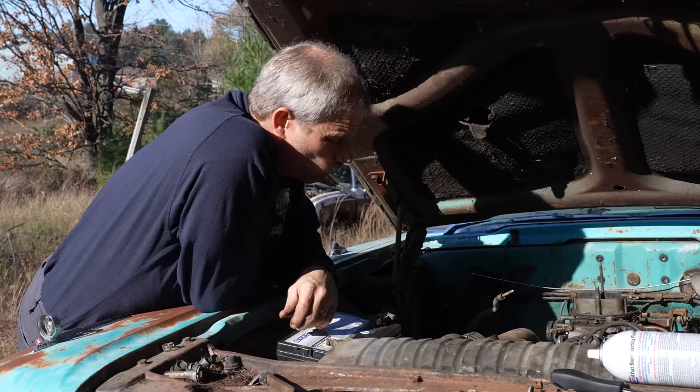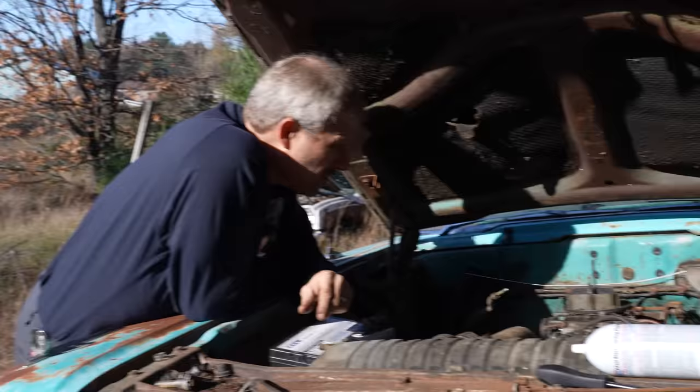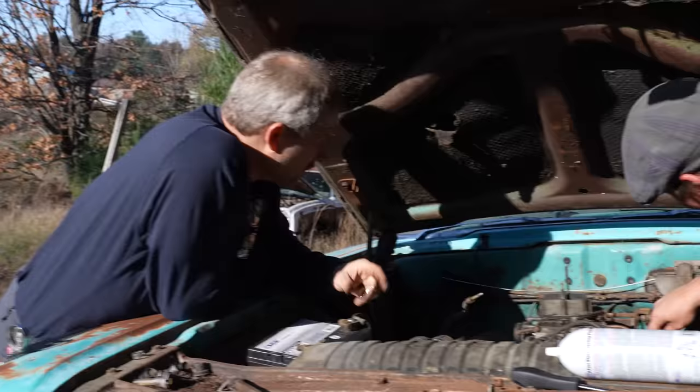I mean, look at it sitting here, smoldering. And there's no reason for it to do that. No. Other than it's creating a lot of pressure inside. Right. And then the pipe still could be plugged. You could still be plugged up high, but you're still getting air out of them, so it's not dead plugged. It's not dead. No. Yeah, it's just not drawing. It's got to be leaking. The intake manifold's got to be leaking it out so it can't draw into the cylinder. But then we still put fuel right in the cylinder and it does the same thing, so. Doesn't seem like there's any way around it.